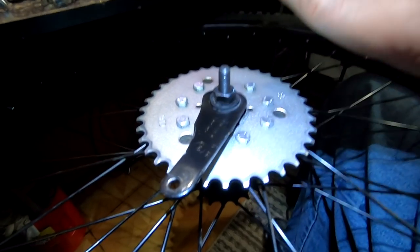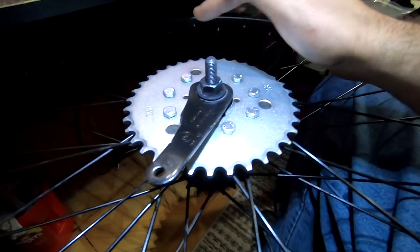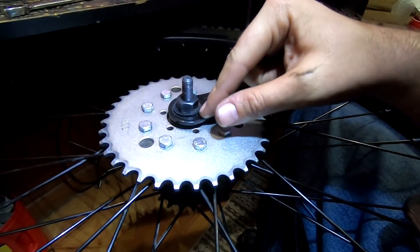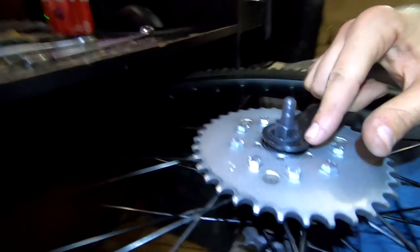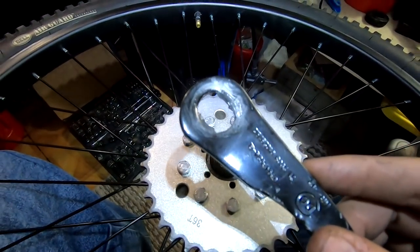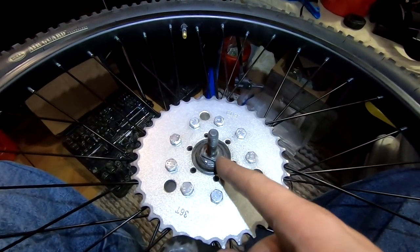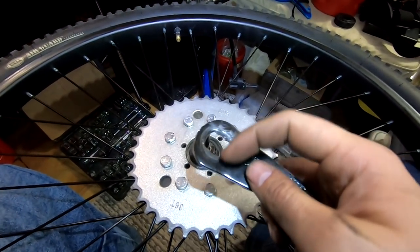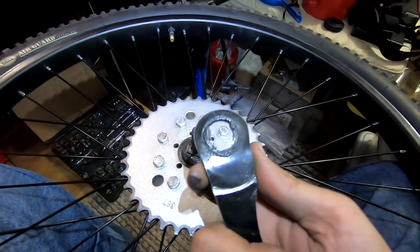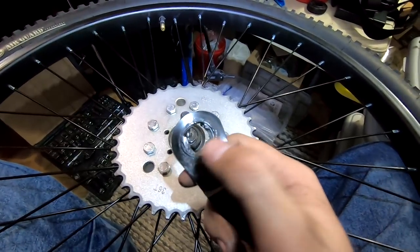All right, we're moving on to the rear wheel. We're gonna see if we can salvage this or if we need to outright replace it. She's definitely loose, but we knew that. What I did notice while I was taking the bike off the frame is it looks like there's a bit of a bulge in the coaster brake arm. Yeah, look at that. The cone nut, this guy right here, it just dug into the coaster brake arm. Whoa. Okay. So this was our failure point.